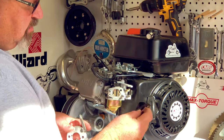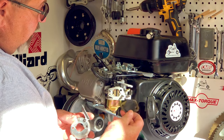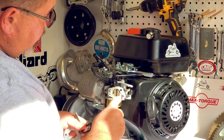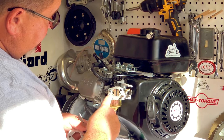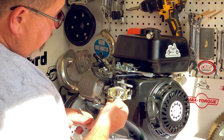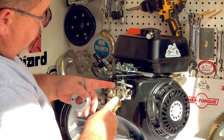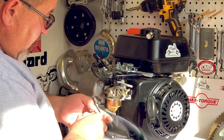You'll need to use this spacer, which is designed to go on one way, although you can flip it and turn it in different directions. You want to make sure that you keep the air bleeds and the vents clear from everything. Go ahead and slide that right on there, making sure the orientation is correct and it matches the carburetor.